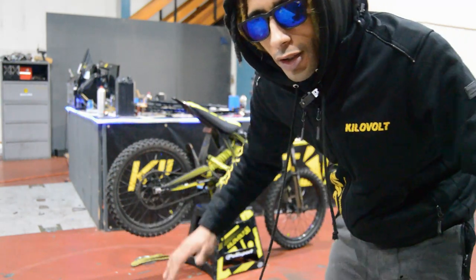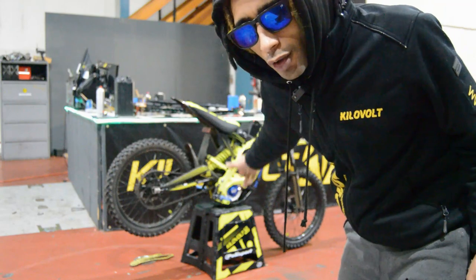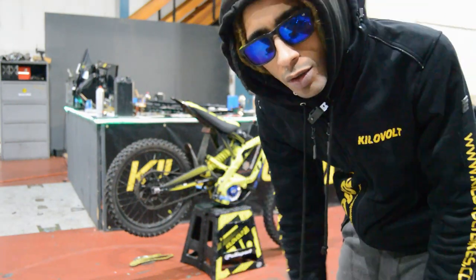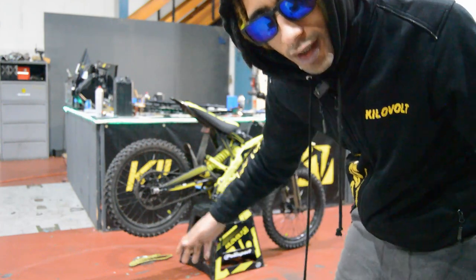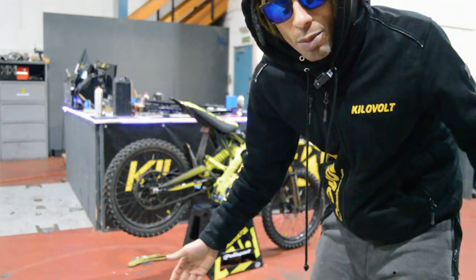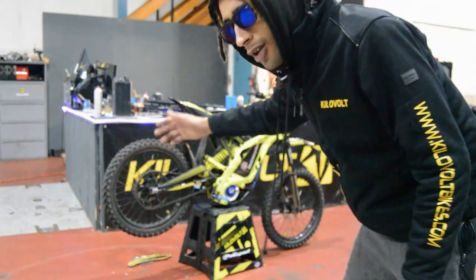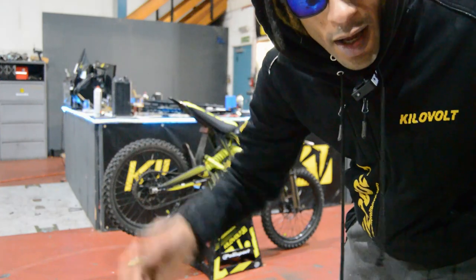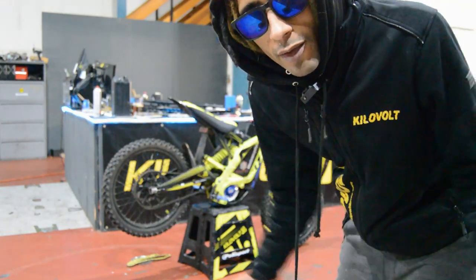So we're back today with our usual style of video, free rides in, and we're gonna have a look around the shop Sur Ron. We're also gonna set it up for some top speed runs. Currently, it's set up for wheelies, so we've got a big sprocket on the back. We're not using as many amps as the controller can push or the battery can let out. So today, we shrink the sprocket, up the amps, and then get it ready for a speed run to find out how fast this thing can go.